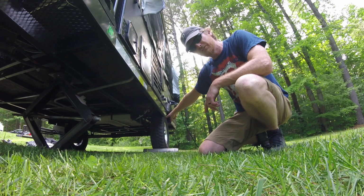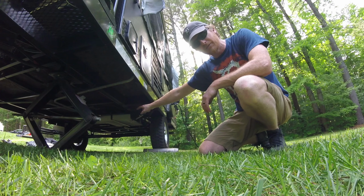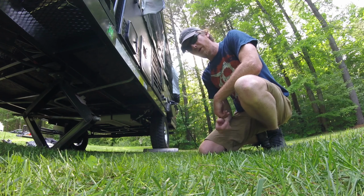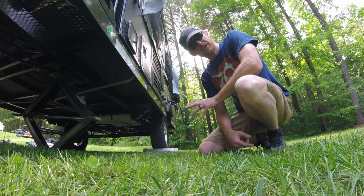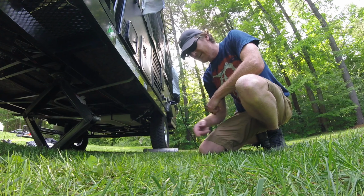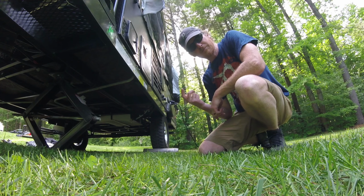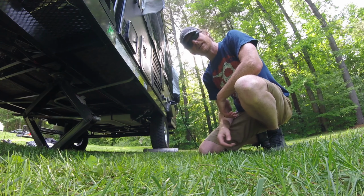A little bit of aggressive wear on the tread pattern on one side and on the outside of the tire on the other side, so I knew it was towing sideways, basically. Brought it back to them. They had it for a couple of weeks. They brought it to a trailer or spring shop, and they said the axle was bent, and they basically re-bent the axle to align it. Once they did that, it tows perfectly straight now.